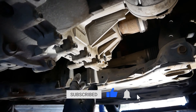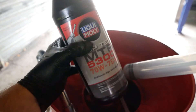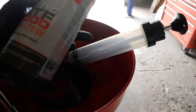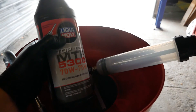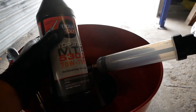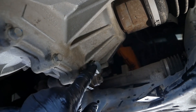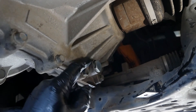Do subscribe if you haven't, and I'll see you on the next video. Just to confirm the oil quantity — I did have to crack open a second bottle of oil. This syringe takes 200 millilitres, and on the last go it was nearly full, so it's near enough 1.2 litres — something like 1.175 litres. And the final thing: torquing both the fill and drain plugs — the manufacturer says 44 newton meters. Anything between 32 and 44 newton meters is fine.